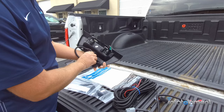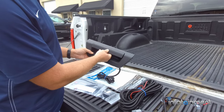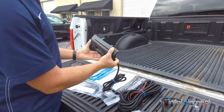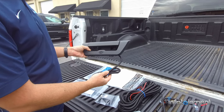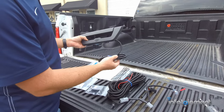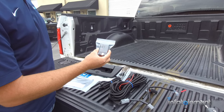What makes our products unique is we use factory OEM tailgate handles. You'll see a lot of aftermarket handles online, but they break easily. There's nothing better than the factory OEM tailgate handle. Basically what we're going to do is replace the handle in this truck, run our wiring to behind the radio display — this will interface with factory and aftermarket radios — and finally program the vehicle's computer with the OBD Genie programmer to turn the backup camera feature on.